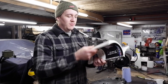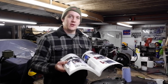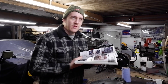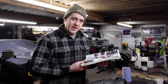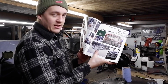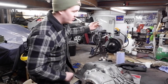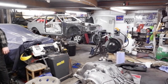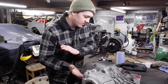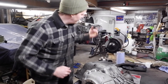In the book they've got the sump on there and I've only ever seen it on Group A cars - probably because they're quite expensive sumps and you need two of them to make one, and it's no benefit over putting a big wing sump on - it's probably worse. But this is the vibe we're going for. I need to cut here, get rid of the middle section. I think it's just 60mm down that they did, straight across the front and straight across the back.